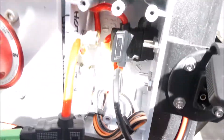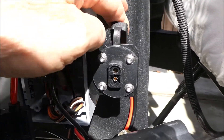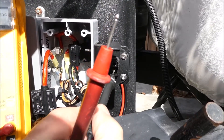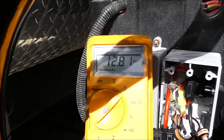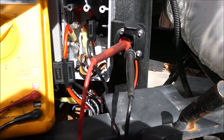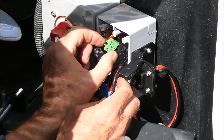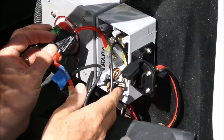That ground wire and that hot wire are coming to this connector. I'm going to make sure I have 12 volts there. This top pole should be plus and this should be minus — the negative here, positive goes here — and we end up with 12.81 volts plus. So that's what I was hoping to accomplish here. Now I need to see if I can shove all that stuff back into that box. I've got two of these big inline fuses in here — this is going to be rough. I have a lot of extra wire here; that's part of the problem.